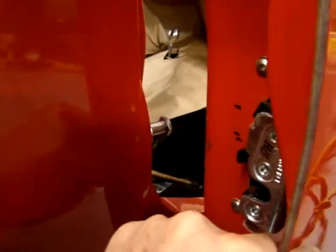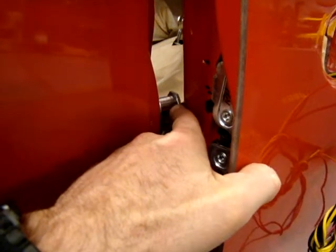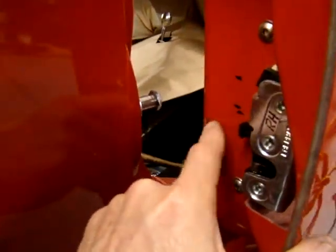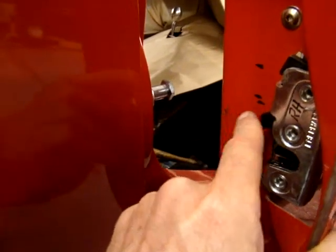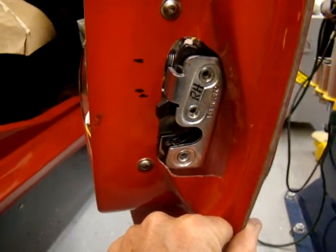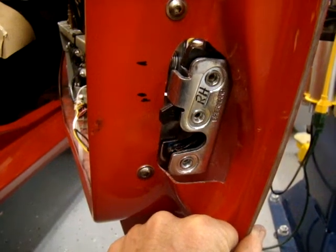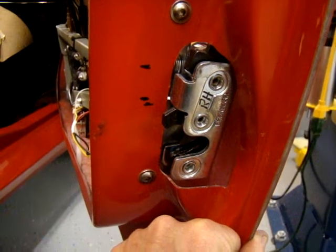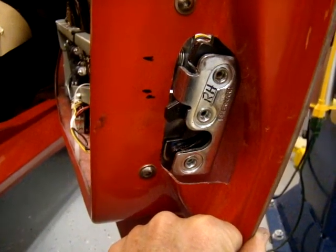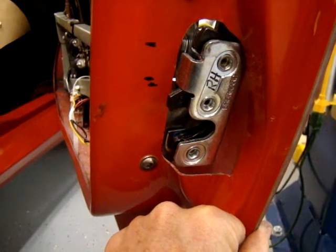I'm just going to dish that out a little bit and create more room for it to slide past. It's at a bad angle in relationship to the latch — when the door is closing you intersect that piece because of the height of the back of the door and the fact that it's 90 degrees to the outside. It should have been angled in a little bit more, but you've just got to make it work. The latch cutout is really big from various cuts I made during different stages. I'd recommend just cutting a nice big opening, getting it right, then going back, creating a cover, and reglassing that area.